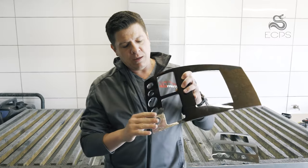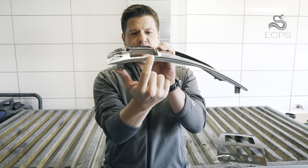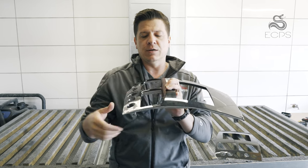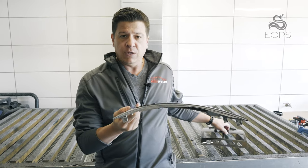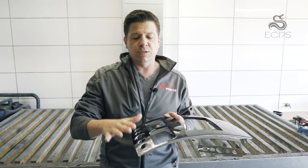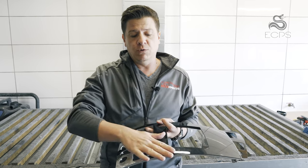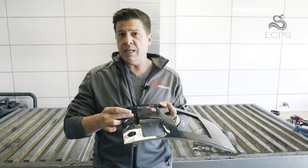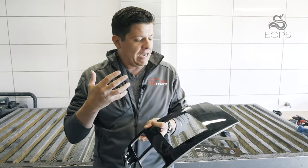What we've got here is the sanded down, or ground down, frame. You can tell how deep this goes, and when you look at it from the side you can see as well — seeing it actually shaved away gives you an idea of how thick this veneer is. You have to get it down that low because once you add in the carbon fiber it's going to be a little bit thicker. Without grinding this all the way down, the carbon fiber veneer is not going to actually adhere with the epoxy you need to keep it in place. And if you put it on top without grinding, that's going to raise the level up to where the buttons won't actually stick all the way in and be able to clip in place.